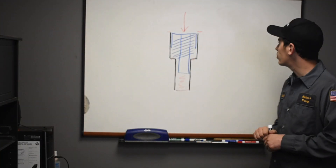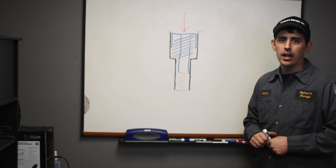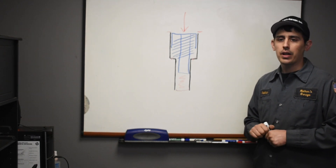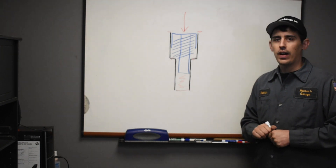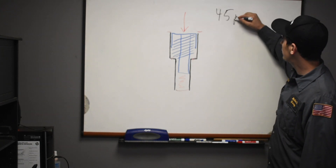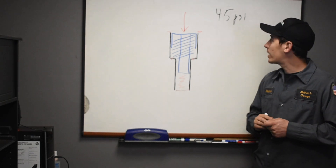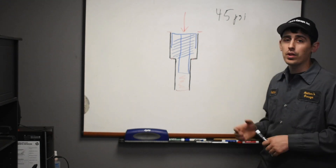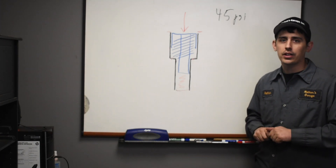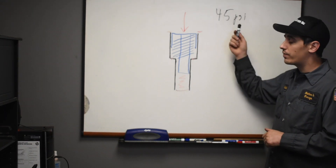Another suggestion: make sure you check your fuel pressure under wide open throttle. The test we did in the shop was just a key-on engine-off test — it's a good indicator of where you're at, but you really need to test it under a load to verify you're not dropping fuel pressure. The minimum spec you should see is 45 PSI under a load. With the blue spring kit installed, I really don't like to see anything less than 60 PSI. Ford's minimum spec is 45, but if you're less than 60 you should start exploring whether you have any other restrictions in the system.